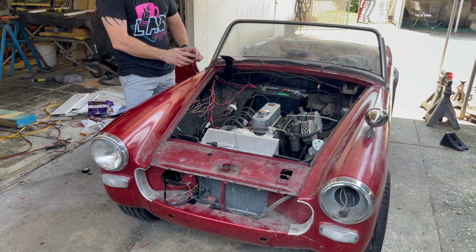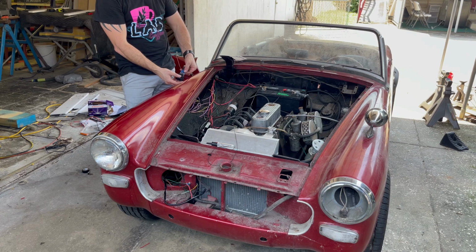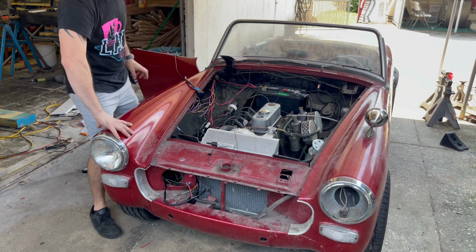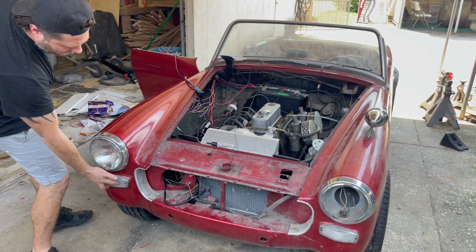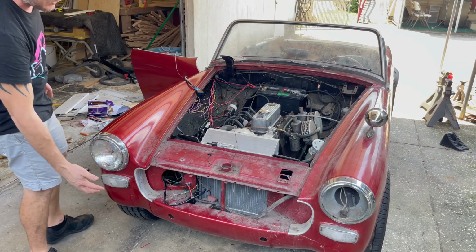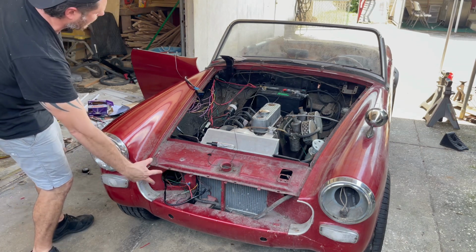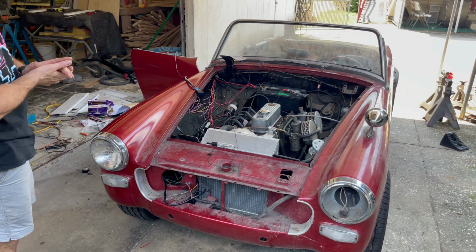And I've already went ahead and switched out the two wires on the back here. And what'll happen is same thing. This side won't work that well. So there's gotta be a short somewhere on this side. So I'm gonna have to take my turn signal out, the light here. There might be a faulty light in there, or one of the wires might be bad, and just send new wires over to here, which I planned on doing anyways. And then we can test the back. So I'm gonna go ahead and try to do that.